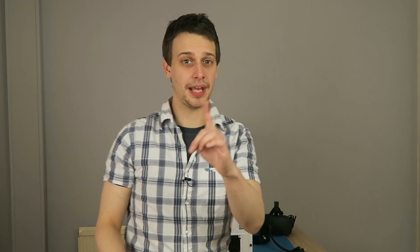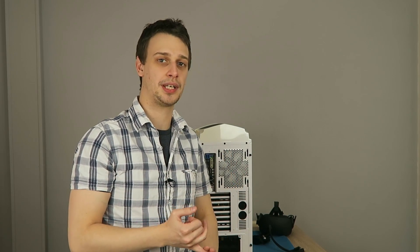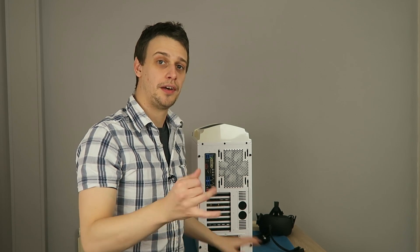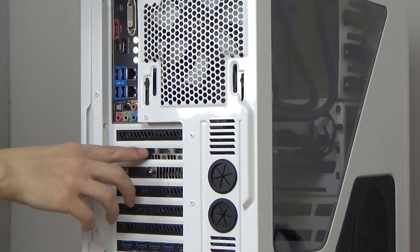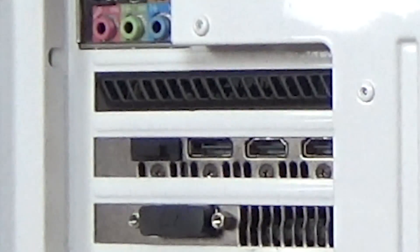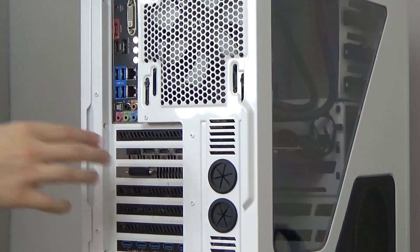What happens if you only have one HDMI port on your graphics card? If that's the case, you want to use an adapter in one of the DisplayPorts for either your monitor or your TV. Monitors and TVs handle adapters a lot better than the Oculus Rift does, especially if you get a decent quality adapter. The adapter you'll most likely need is a DisplayPort to HDMI adapter — the DisplayPort looks very similar to the HDMI port but just has one angle cut out. A link to the one I use is in the description below.